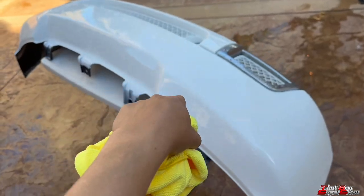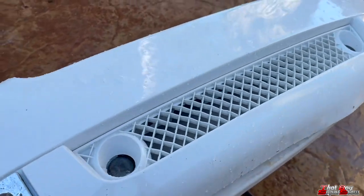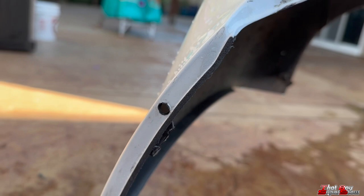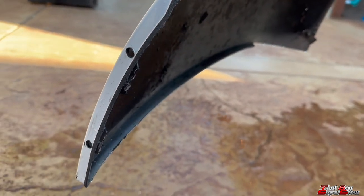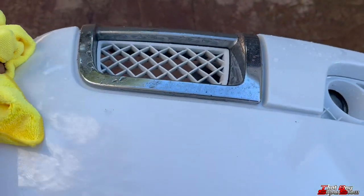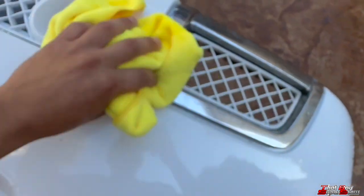This is the lip I was referring to — you see how it ends here. I gave it a quick rinse and I'm gonna dry it and head out to Home Depot to buy shorter screws. The bumper curves, so when the screws come in — I think it was about a good inch — they begin to rub on the inside end, making it really hard to tighten. So I'm going to get half-inch screws so it goes in smoothly. I'll go ahead and dry it before we head out.